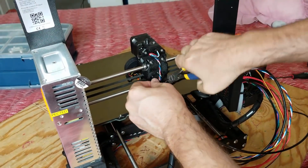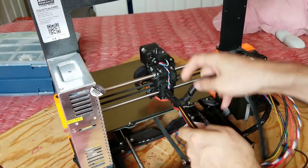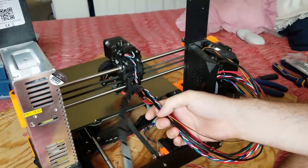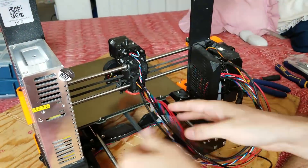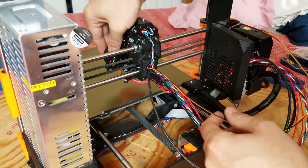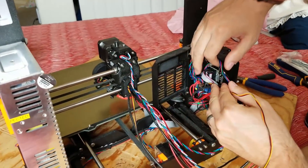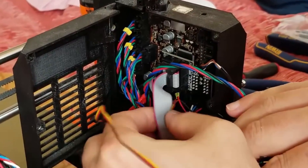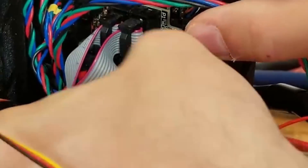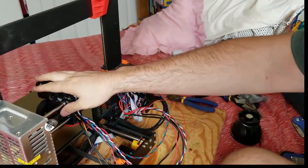There we go. Oh, there's that wire. And so now there's my fan wire — this guy. So I'll go back in here, and see — he attaches right there. So I'll just pull him out. It's got a little thing I've got to push in. There we go — she's out now. So next, let me take some of this apart and see if I can pull this wire through. Let me get this front off here — should just be these two screws to get this off. First let me get this lower fan duct off. This redirects it.